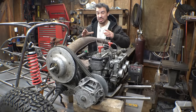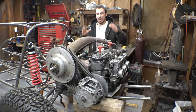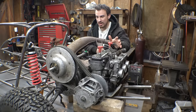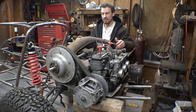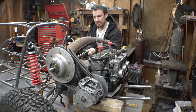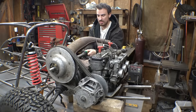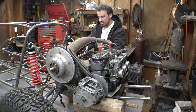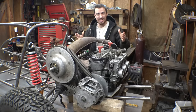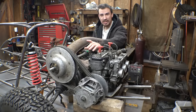So we got the jack shaft in place, and the secondary pulley is mostly where it's gonna go. Because everything is so compact and crammed in here, I'm having to figure out where everything has to go before I can add any tubing. The next thing I need to do is figure out the mount for this second bearing, because right now the jack shaft is just sitting here with only one bearing tacked in place. We need to figure out first where the expansion chamber is going to go, but we can't do that until we get the fiberglass in place.